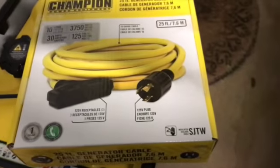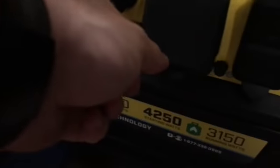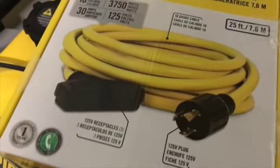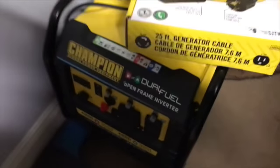Champion, the technical person I spoke to on the phone, said they do not actually make a plug that fits this one, but it's called a TT-30P. It is still an RV plug, 30 amp, 125 volts, but it's shaped different. I'll put a link in the description to one that I found that actually works, and there's a bunch of them if you search TT-30P. Evidently most of the Champions must have used to have this kind, and then this is a different kind. I didn't want you to make the same mistake I made.